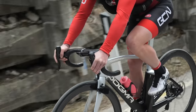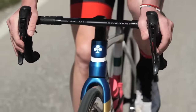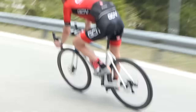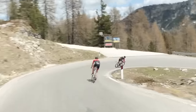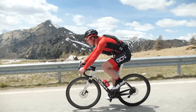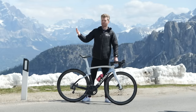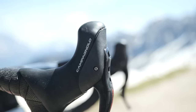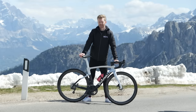What's the point of dragging the brakes and trying to melt them? This isn't good braking technique. Ideally, you brake into a corner and trail brake in the corner if required, then release the brakes on the straights. This allows you to go faster and lets your brakes cool down. However, it is important that brakes can survive more than that, because some riders — often those less experienced — can get scared on descents like this and drag the brakes. Full transparency: we approached Campagnolo, the world's oldest manufacturer of groupsets, and asked if we could try to melt their hydraulic brakes.